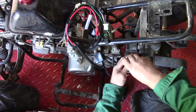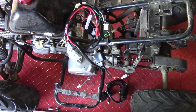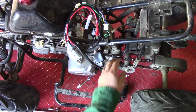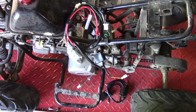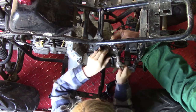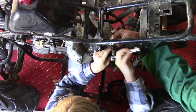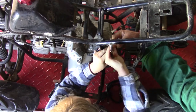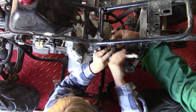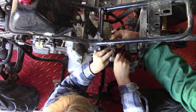I think I've got the plug backwards — need to turn around. We need the little ratchets to take this one off. These are nylon nuts, so it'll be hard to unscrew all the way until you get past the nylon. The nylon acts like an anti-lock — it purposely makes it hard to get the screw out so it doesn't vibrate loose. It won't loosen up until you get all the way past that nylon.